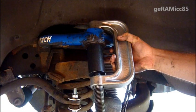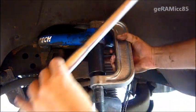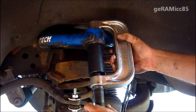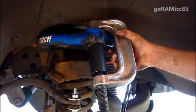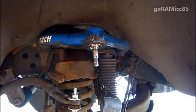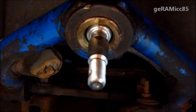It worked very well actually. I got it in real easy. It is hard to turn but if you use this long wrench to tighten it down it slides in real nice. You notice when it's at the end because it gets real hard to turn — that's when the ball joint is in all the way. You don't want to break anything. Got the first ball joint pressed in. Looks real nice.